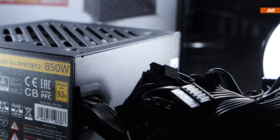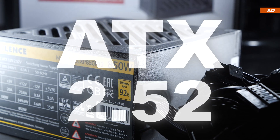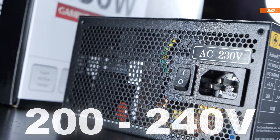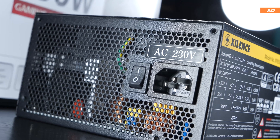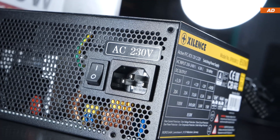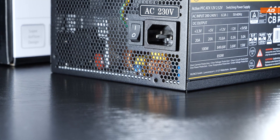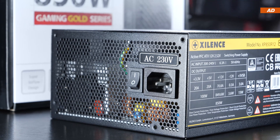It's just as obvious we are not dealing with one of the latest ATX 3.0 models, but instead just good ol' ATX 2.52. I was a little shocked at first when I noticed the input voltage only goes from 200 to 240 volts, and unlike most other power supplies out there, does not support 100 volts and up. This means this PSU can only be used in specific countries and regions that operate on the 230-volt power grid, such as Europe. There's no automatic switching and no dedicated switch for that — but for us Europeans, that's not really a big deal.